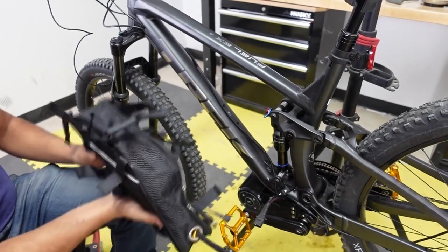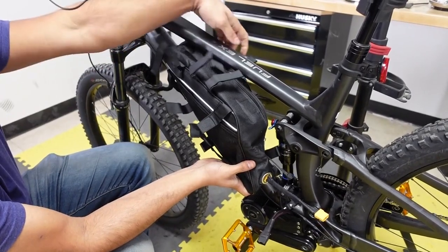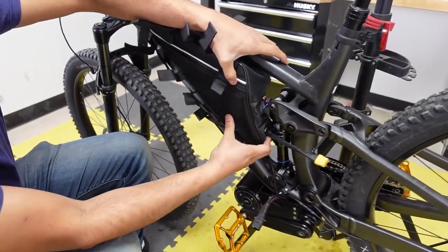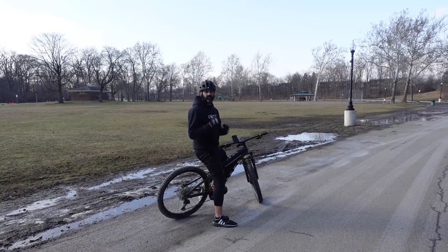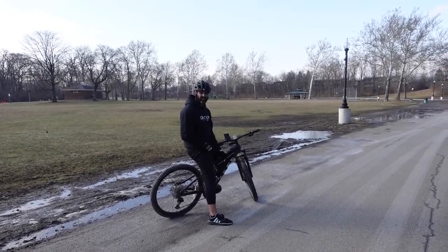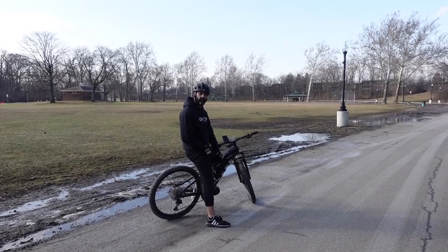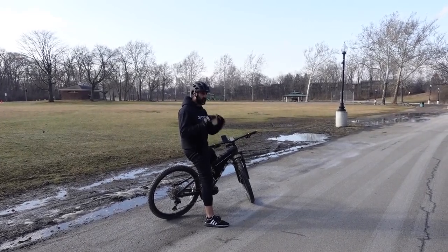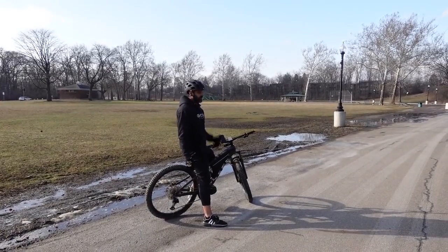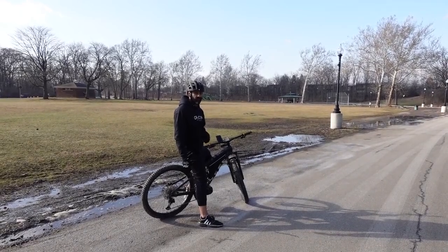Last step — mount the battery, plug it in, clean up the wires, and it's time to take it out for a ride. We're going to do a top-end speed run with the X1 Pro. We're running an X6 controller rated at about 3000 watts of power and a 52-volt battery with 60A discharge — right at about 3000 watts. But not all watts are equal — if you want the top-end speed you need a 72-volt battery.